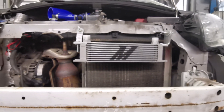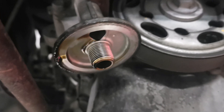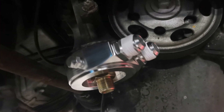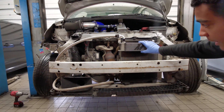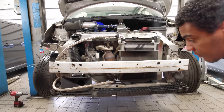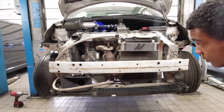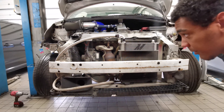I'm just going to tidy this up by cutting off the threads that we don't need — it should look a little neater. I've taken the oil filter off, and now I'm going to test fit the sandwich plate to see how I can make this work. The sandwich plate is on now; I just need to finalize the position and the routing. Here we have the oil cooler mounted up, and I'm now attaching the hoses to the in and out sides, directly to the sandwich plate just to test it out for now and make sure everything's working as it should.